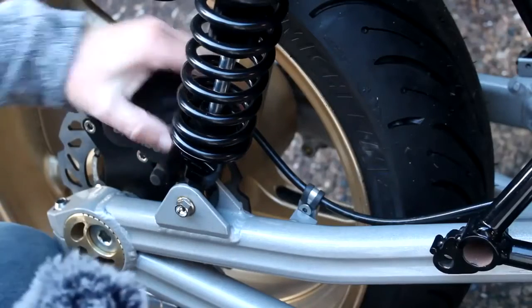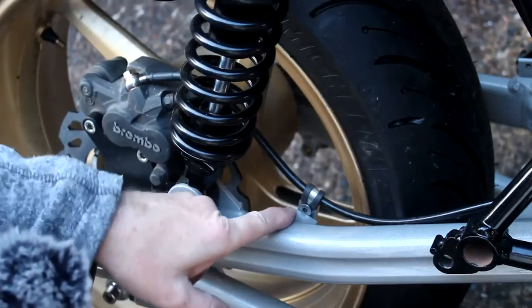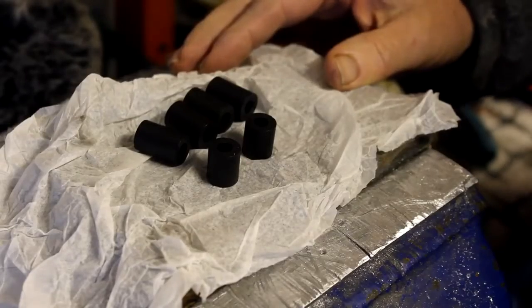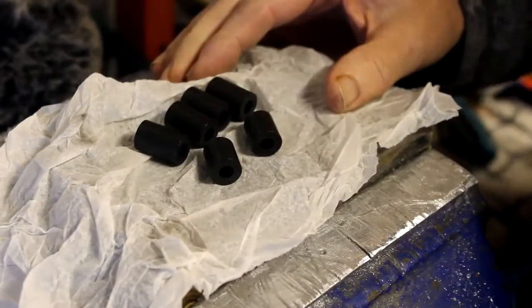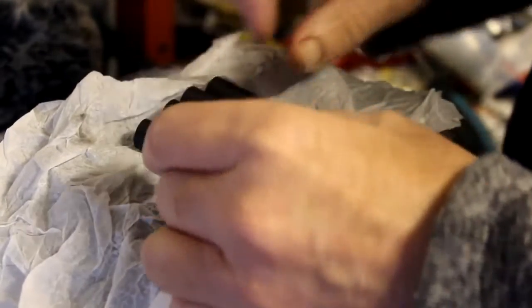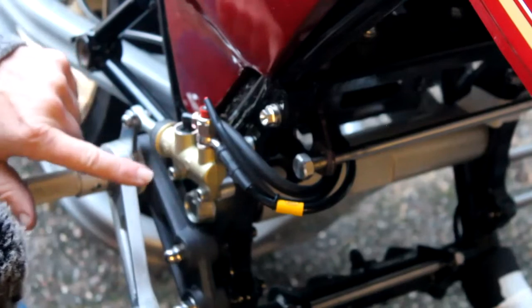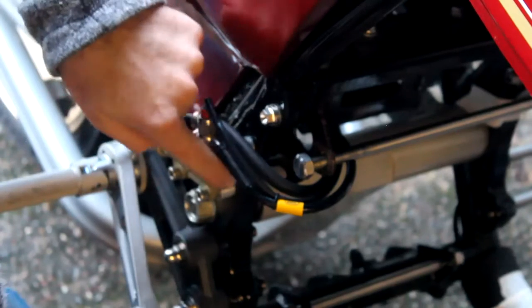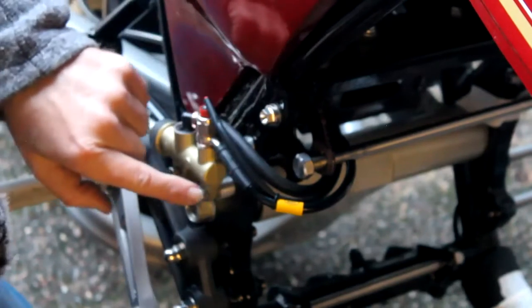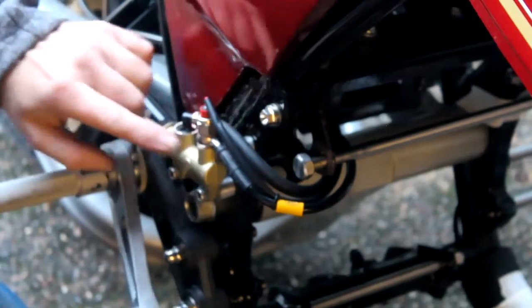All that cutting and filing was just to make a little bracket to mount the rear brake line keeper in just the right spot right there. Next up I need to fit two of these — some black anodized spacers I've bought from eBay. I need to replace two spacers I've already used on the bike because they weren't quite right, so I've got these to fit instead. The two spacers — once replaced on the bike — are here and here, and they mount the rear Brembo master cylinder to the new bracket I made some time ago.